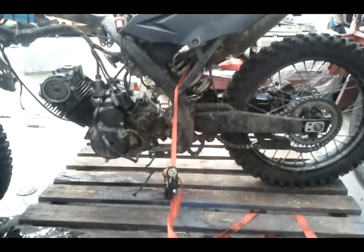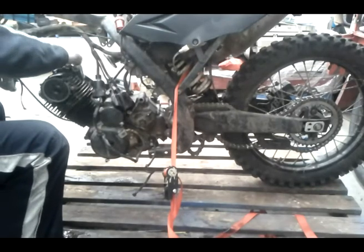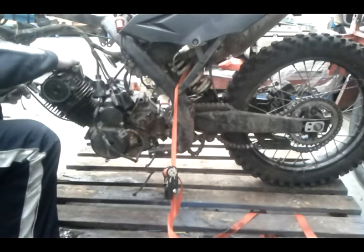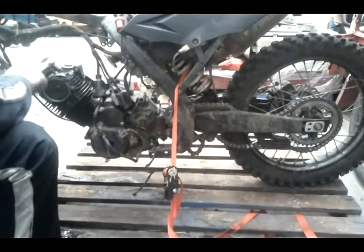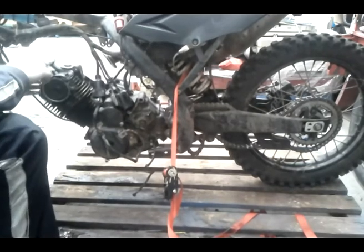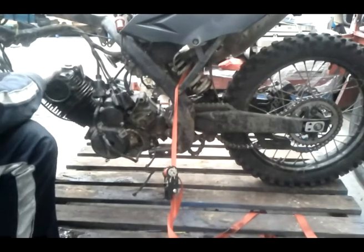Don't tighten one all at once, because it's not the correct way of doing it. You go around bolt to bolt, and even though you thought you'd tightened one, go back to it and give it a little extra, because the other bolts help compress the head gaskets and the gaskets under here, making them loose again. I tightened that one up pretty tight, but when I go back to it, I reckon it'll be loose again. Yep.